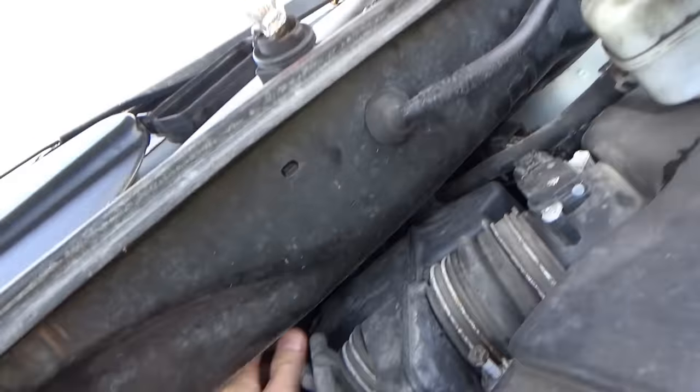I guess the fender liner is a little ripped around the factory hole. But now, why not just use that one? Oh, the bolt is still in the factory hole. How about we just unscrew that and put the fender liner back on the way it's supposed to be? Insanity. So wanted to open up the harness here just to see the extent of the damage, because we want to fix this long term. And the only wire that got compromised is that white wire going to that resistor. That's surprising, but that's quite the big gash just in the white wire.